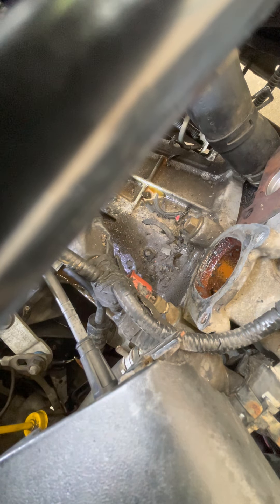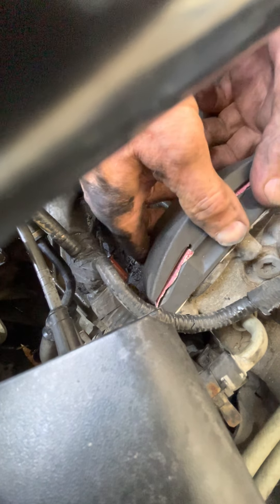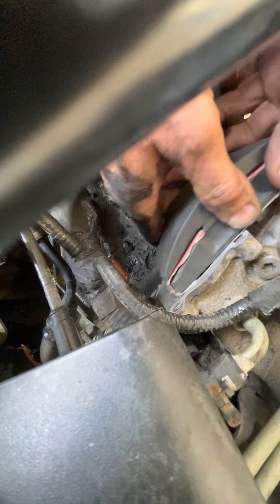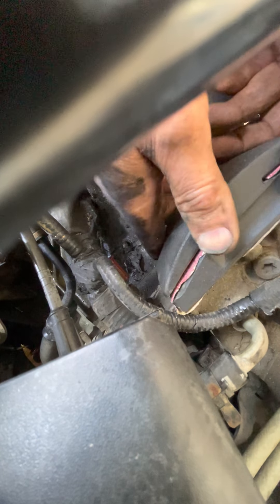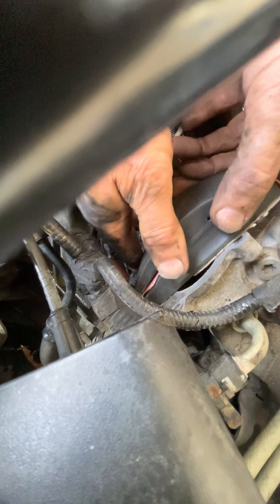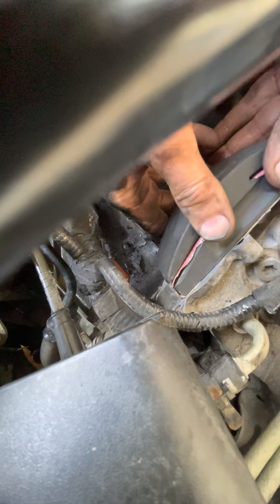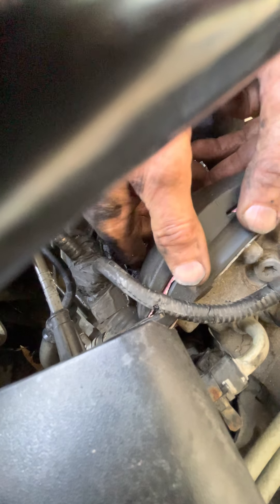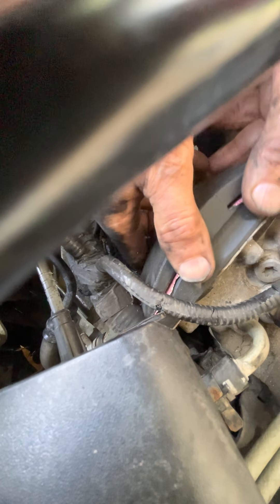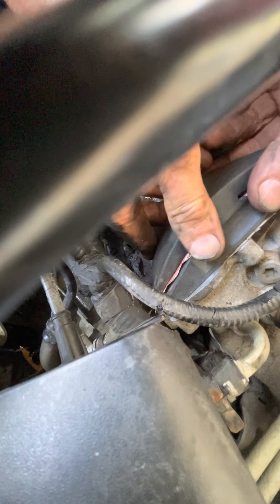You don't want to scratch that surface up, because if you scratch it up too much you'll create a pathway where the water can go. So then I'm going to get my sandpaper and mess around with it a little bit. In my opinion, anytime you drain and flush, you should replace the thermostat. And you should replace it with an OEM — not a lower temperature thermostat — unless you have some particular reason why you'd want to do that.